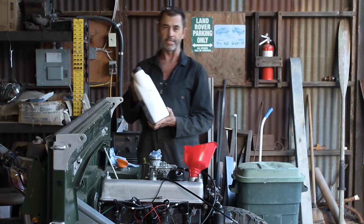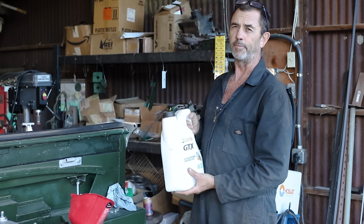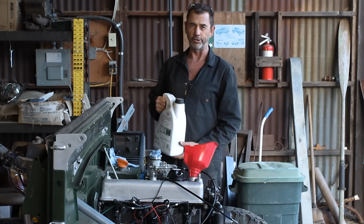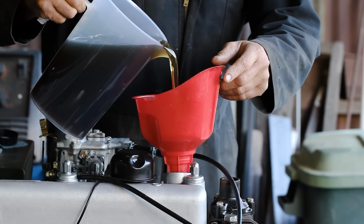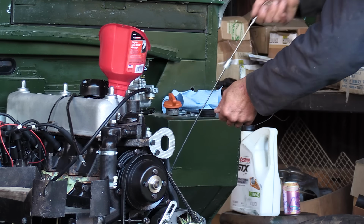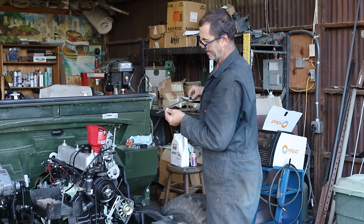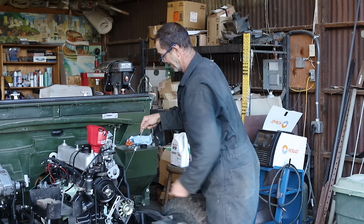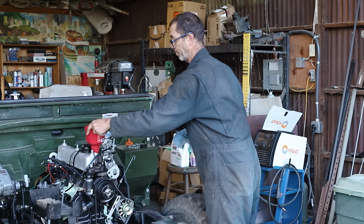I'm going to be using the Castrol GTX 10W-40, which my engine builder Roland says is an excellent choice, and the Haynes manual also says I'm a bloody good bloke for my choice in oils. Right, well, we're still a litre short from the recommended dose. It's reading full on the dipstick, so that should keep us out of trouble. And we'll monitor that situation as the time approaches.